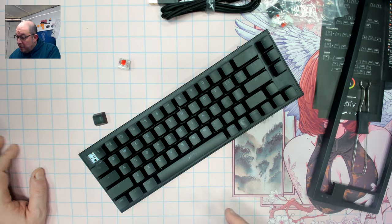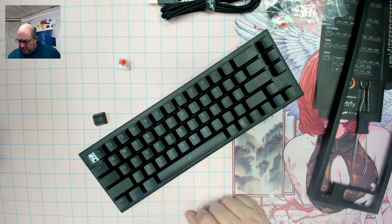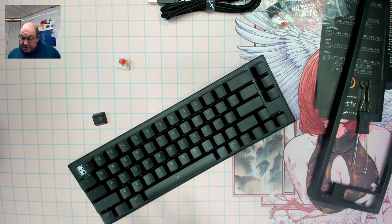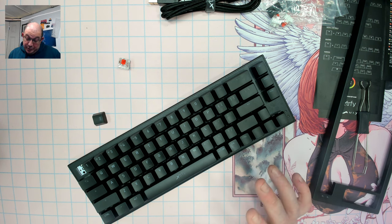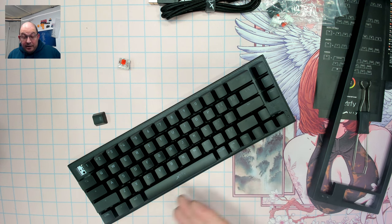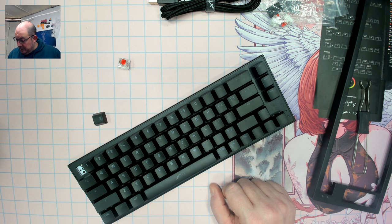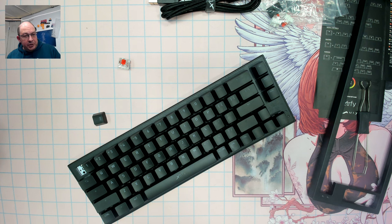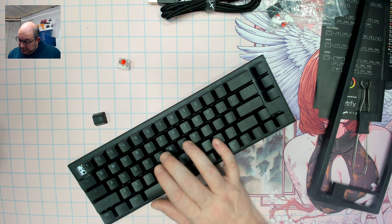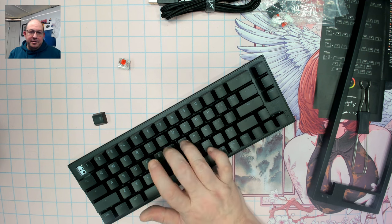I don't know, the keyboard starts at $129 with, I believe, these switches, the basic cables. And since it is a steel plate, using any switch that isn't lubricated that has ping, all it's going to do is the plate acts as a speaker almost for the reverberation that the switch can cause. It can actually cause other switches in the keyboard to make noise, by a tiny amount. And all I can hear is the ping.